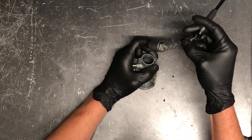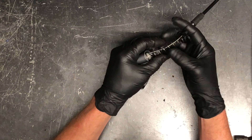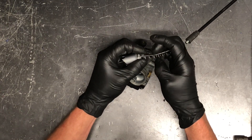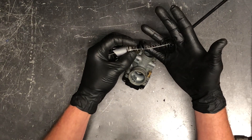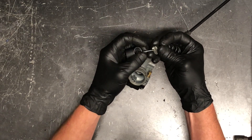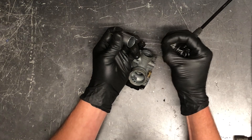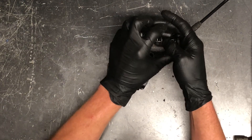Take these two screws out with a flat screwdriver and set them aside. Then you can slide that cap off — everything comes off: you've got your slide, your needle, a plastic bushing, your spring, and then your cap. Since the cable is unhooked from the throttle housing you're going to have a whole lot of slack. If it was still hooked up, the spring would be loaded and it'd be more of a challenge. I run that cable through my middle fingers, pull the cable up, keep that bushing attached to the spring, then pinch the cable and push it out through the larger groove.